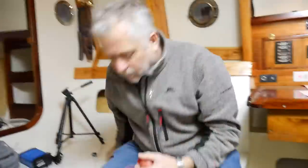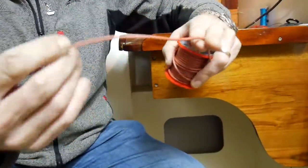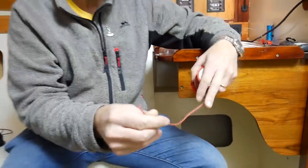I've splashed out. In the past I've wired with any old stranded wire I could get hold of. It needs to be stranded and not solid core because stranded can flex and doesn't suffer from metal fatigue nearly as much — so stranded wire is important. I wired our previous boat with speaker cable with transparent insulation and it worked fine. But this time I've done it properly: I've bought tinned copper stranded wire with silicone insulation. It's lovely and flexible — beautiful stuff.